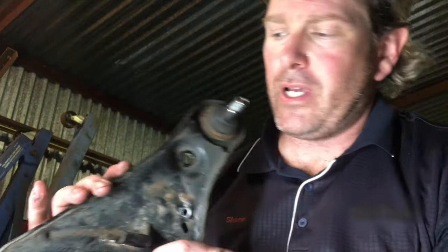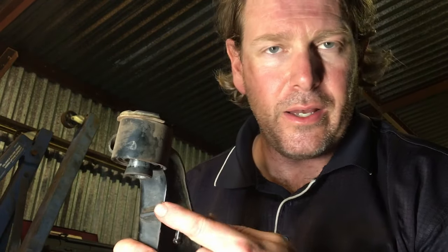Access may be a little bit different on the other side — I'm going to move on and do that job off camera, as there's not really much point filming both sides. Also worth mentioning: the section where the suspension height sensor attaches could actually be a different length on the new arm compared to the old one, so there is a possibility we're going to have to redo the height calibration. I'm going to do that in a separate video coming up soon, because I've also got a rear height sensor I need to change out. If you don't want to miss that, don't forget to hit the subscribe button and the notifications bell. Thank you very much for watching — if you like this video, throw a comment down below. All comments help the YouTube algorithm. Thanks very much for sticking with me and I'll see you in a future video. Cheers, guys.